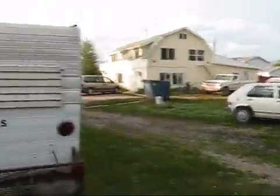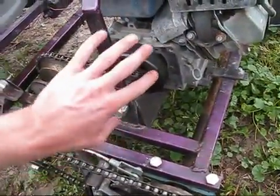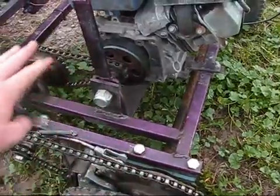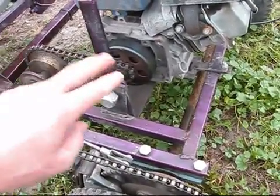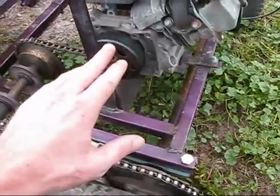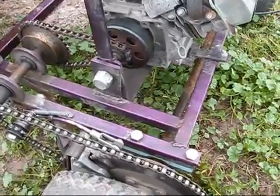Clutches and torque converters vary widely in size and usage. On go-karts built for racing, the clutch is designed much more heavy duty — because most of the time those do not have a jack shaft setup. It goes right from the clutch to the sprocket, and those are designed with more oomph to handle the speeds the engine puts out.